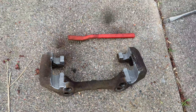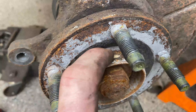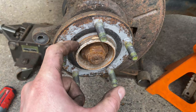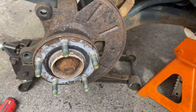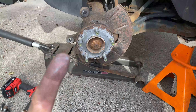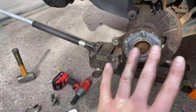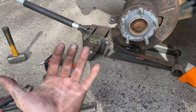We're also going to do the same thing on the hub — take the brush and hit this inner lip that has orange rust buildup, all the way around. That's going to help get the rotor off next time we do a brake job. One note on anti-seize: one tiny speck gets on everything you touch — your wrench, your clothes. Maybe wear gloves and have rags handy.